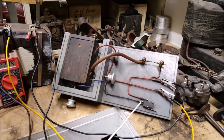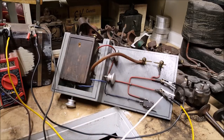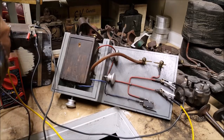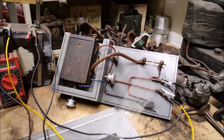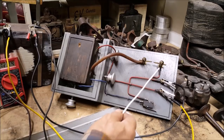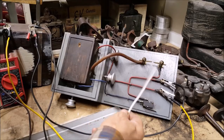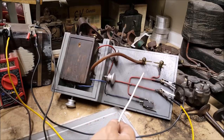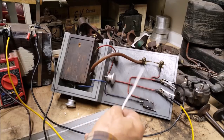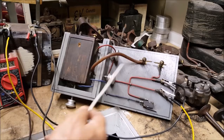The inner there — that'll be the ground right there. Comes off up on the top, comes around over there, comes around to the hot post on the battery. The other side of the switch comes around and then jumps over to the ground side of the spark plug.